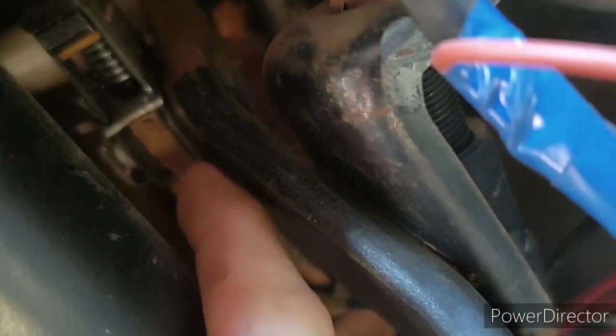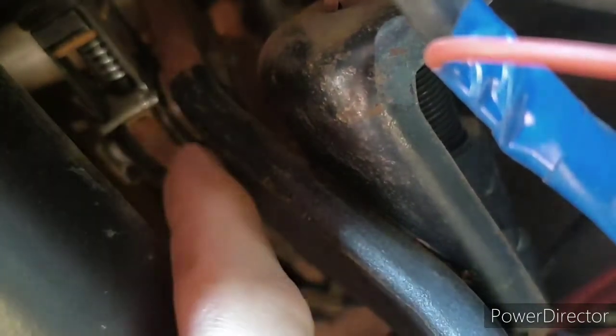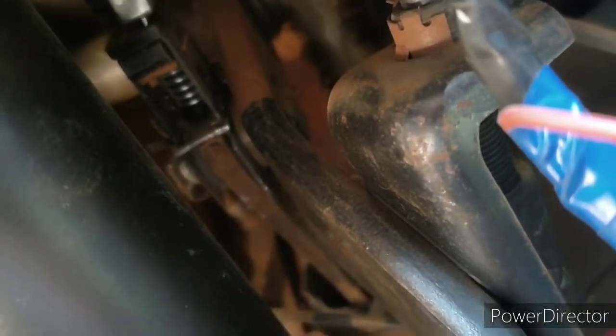You gotta pull it out, and then you gotta pry. So this pin right here you gotta pull out, and then you gotta pry this whole bar here over from that bar. Just stick a pry bar in there once you get that other pin over there out, because this pin on the brake bar does not come out on mine anyways. It's welded on there, so I had to pry it apart, and then it just popped off and got loose.